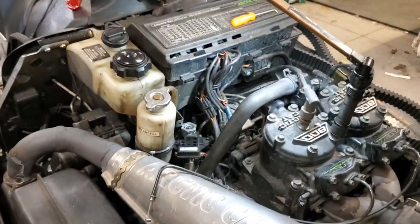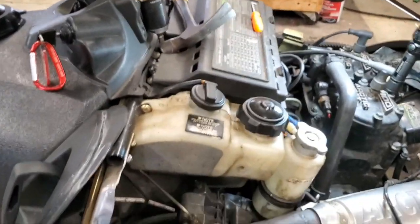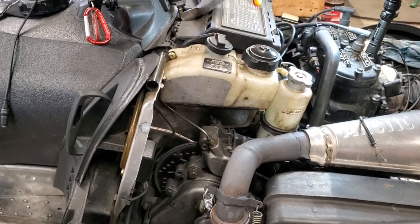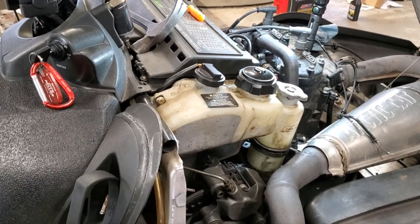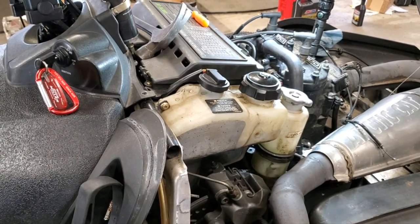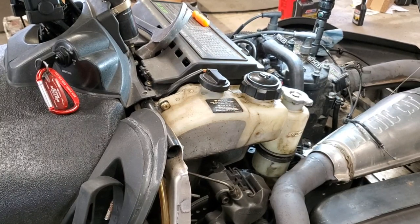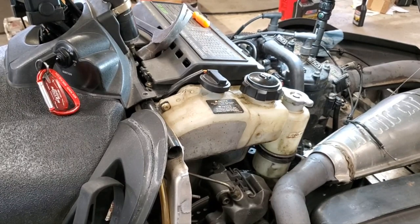So basically, let's see if I can get you set up over here. So basically the fill plug is right here. Okay, so you need to take out, I believe that is also a 7/16, take out that plug and then just top that off with, I'll have to look up the number, but I believe it's 9 ounces of chain case lube. So let me go ahead and get set up and we will get that done. So one second.